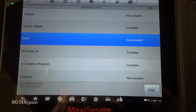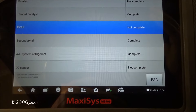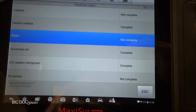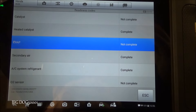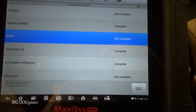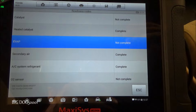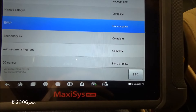I had to disconnect the battery to fix an SRS problem on this vehicle, so it's a good time to talk about emission readiness monitors. Emission components are required on most modern vehicles to control pollutants from entering the environment — things like the evap canister, O2 sensors, and catalytic converters are all examples of emission control components. As part of the OBD2 protocol, vehicles are required to monitor or test these components to make sure they work — this is called emission readiness monitors.